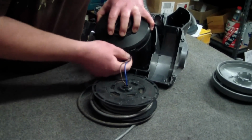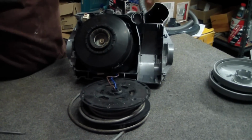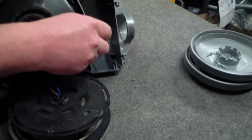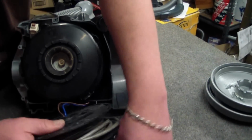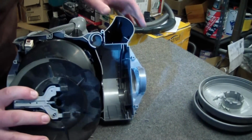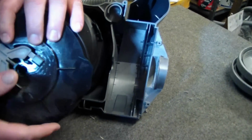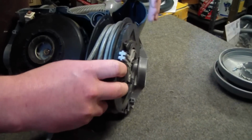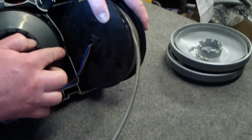And now the good bit that everyone wants to know about. Basically, what I'm going to get you to have a look at is inside the well where the retract sits, there are 2 grooves and then a recessed component. That's the part that is critical. What you need to do, yeah, go for it, if you want a flashlight on that. Okay, so here we are. This is our little well. That has to line up with our tongue on the retract. Now, when you're popping this in, you're going to need to line up this circular bit, like an axle, with this part here.